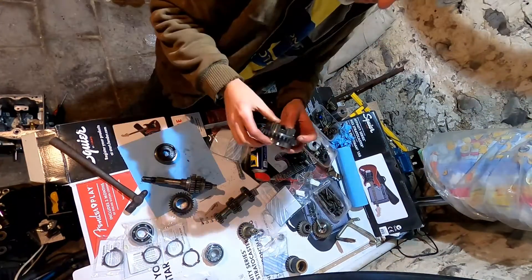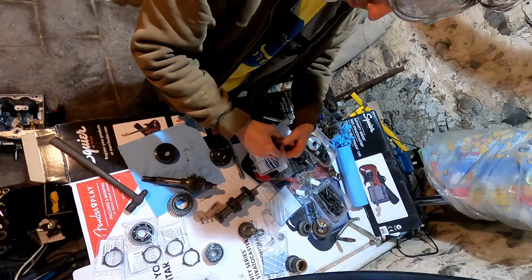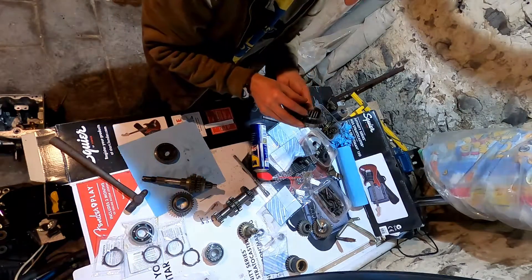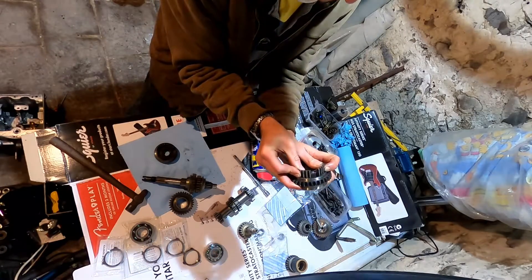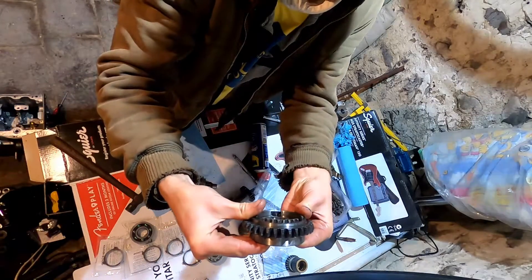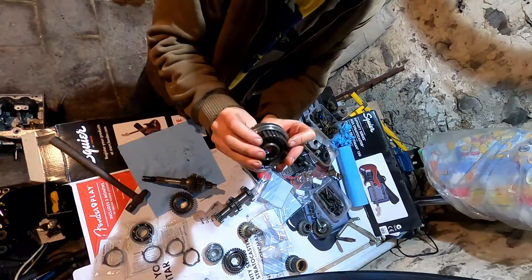The next thing is the ball bearings and the springs that actually give you the positive feel on the gear changes. I'll try and get those in without making a big mess of everything — already making a mess of everything. In theory, when I push... the ball's everywhere. There we go. So this is what gives you the positive feel on gear changes. I'm not going to play with it too much because I'll just lose them all again. There's that one, and the second synchro here which doesn't have any ends at the moment.